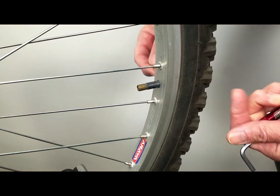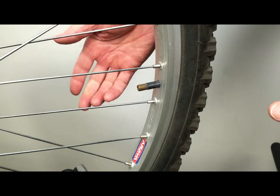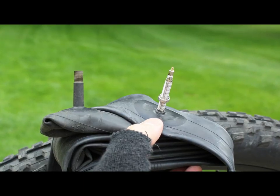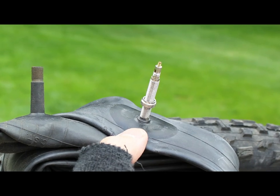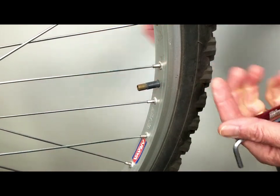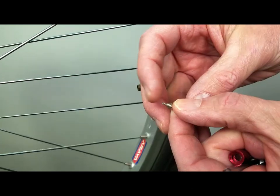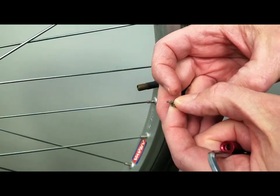The diameter is a little bit wider. It has that screw-off cap. I'll flash on a picture of a Presta valve real quick so you can see what that looks like and the difference. Schrader valves have threads on the outside. They've got what's called a core — a valve core — and that little valve core operates on a little spring.